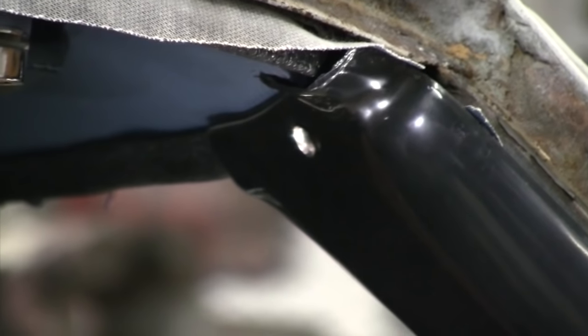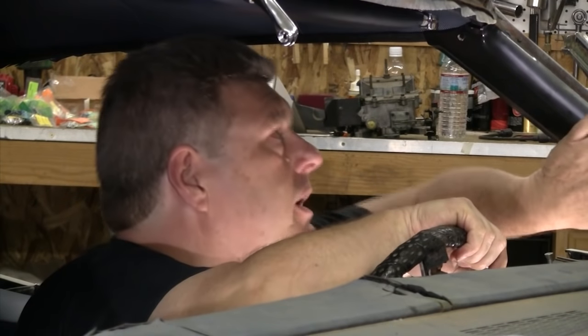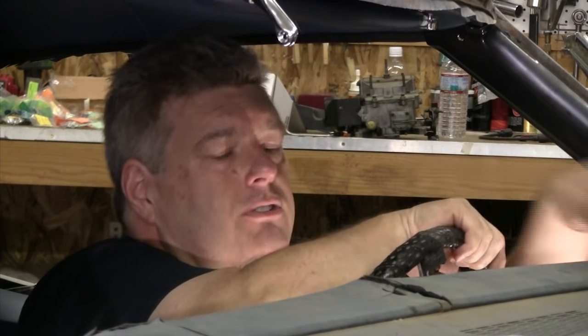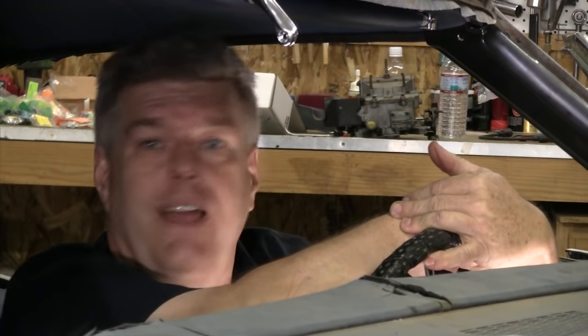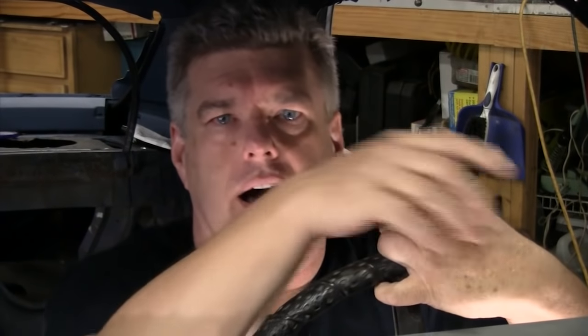So that's basically everything kind of in position. You've got the A-pillars that need to go in. You can't do the trim till you do the glass. You can't do the glass till you do the outside perimeter color. You can't do the outside perimeter color until you do the dash. That's our show for this week, folks. Come back next time — we're going to be doing some more cool stuff. I'm not going to tell you what it is because every time we do that, it just doesn't seem to work out. So watch this next time on Auto Resto Mod. Have a great week.